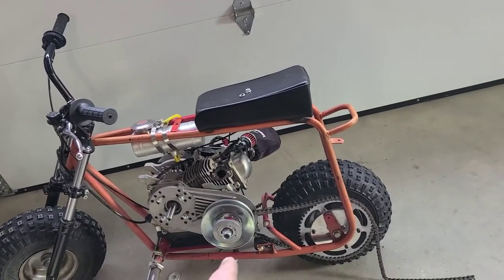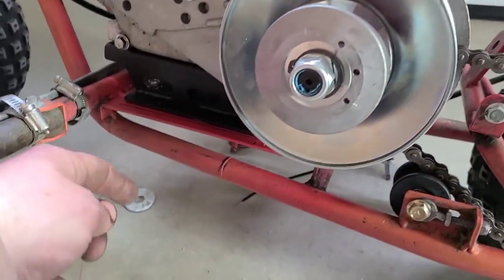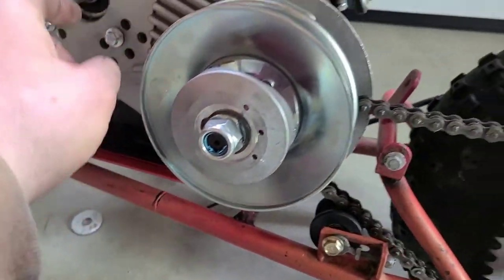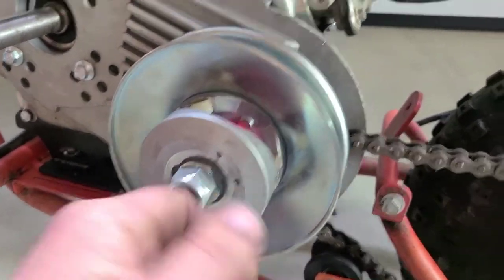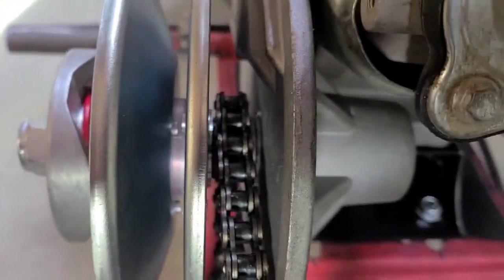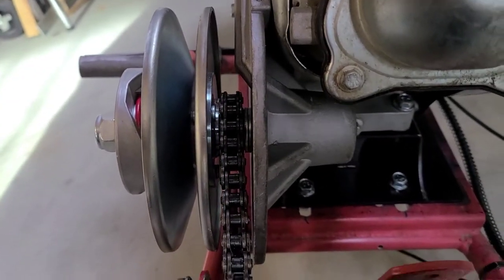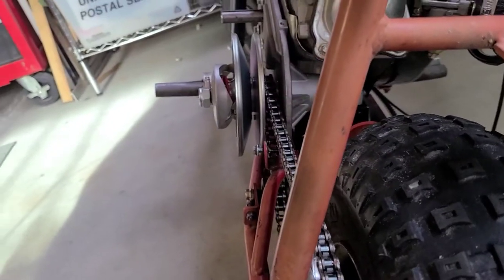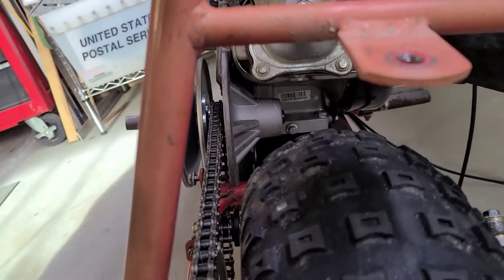The back pulley is loose. Remember we talked about cheating this up here. And when I did that, we had to use the old washer trick I showed you guys. So we're all the way inboard on our washers, and that's giving us our space out here. We got nice chain alignment. Bring it back here, we're nice and straight. See?